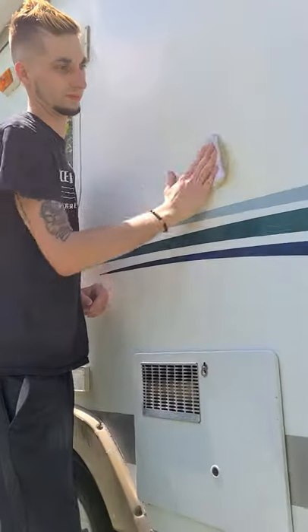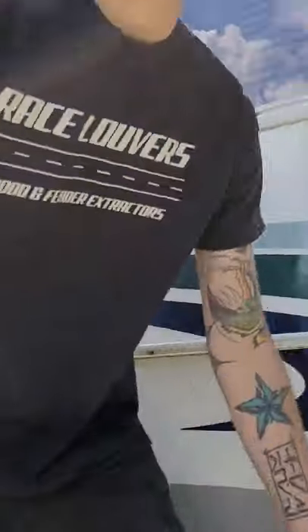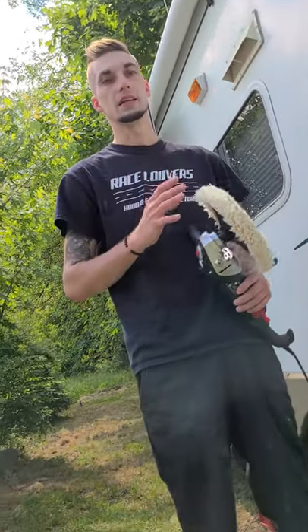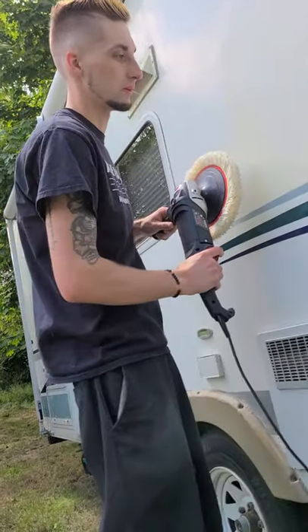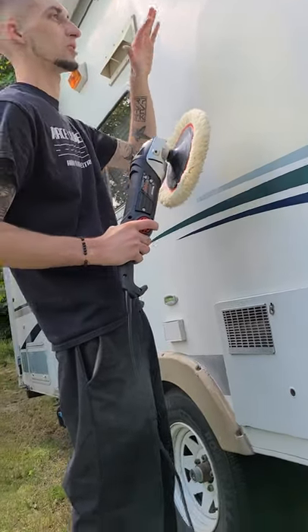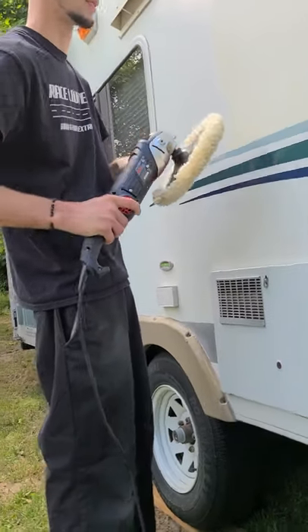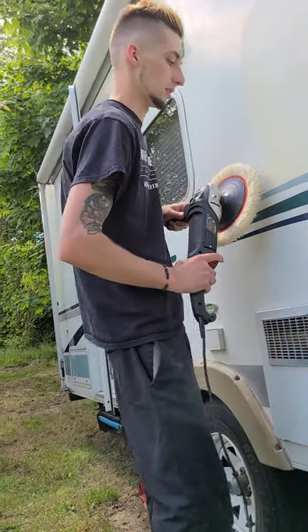It's working pretty good. It's a pretty hot day — about 75 to 80 degrees — so we don't need to let this sit long to dry. We're going to start with the buffer on a low speed. When compounding, you want to cut on a lower speed so the compound really works in — this is not a waxing step; waxing will be more of a high speed. Use side-to-side movements, then up and down, to avoid a hazing effect. I'm starting between speed three and four — find what works best for you.